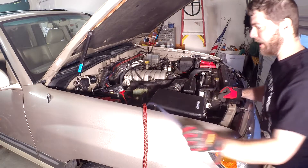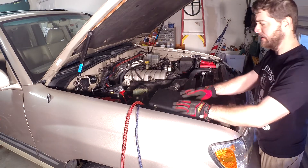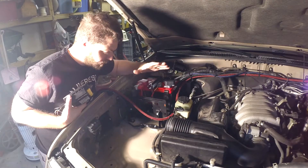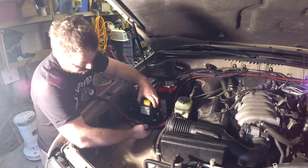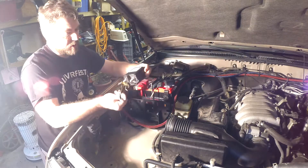To do this final step, I have decided I'm going to take the air box out, just because it's going to be nice and easy to get in here and work on getting the ML-ACR switch in. This is more like it — I have a lot of room to work in here. Here's the switch, so it's going to mount right here. I need to trim this wire, get a connector on it, and hook it up here.